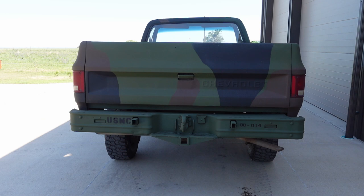After 30 days it's a lot more reliable. I've taken this truck out, scratched it up, and washed it — you don't see the scratch marks. You wash it and they go away. If you can let it bake out in the sun through a summer in the 90s and 100s, that's perfect. And for touch-ups — like on the hail-damaged truck — I just went out with a paintbrush and dabbed over the spots, and it blends in really well. You can't tell where the repairs are, which makes this awesome for rock crawling and off-road trucks. Touch-ups take two seconds, no mask needed, and cleanup is just soap and water.